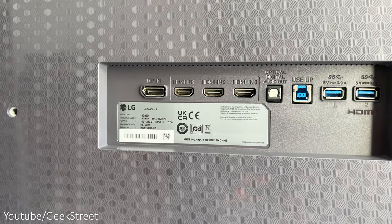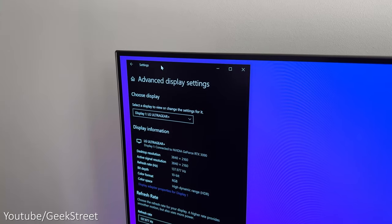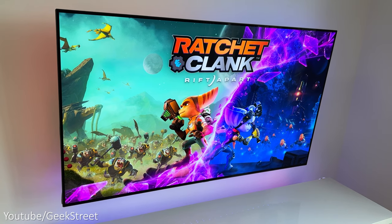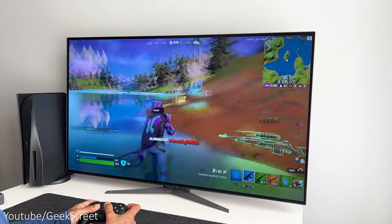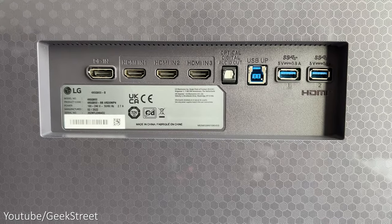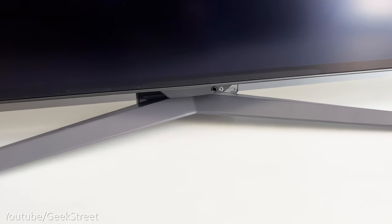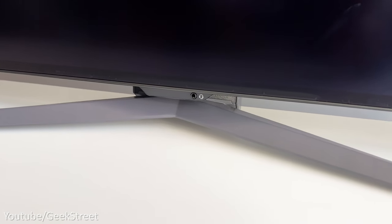Next are the interfaces — you get three HDMI 2.1 ports plus a DisplayPort 1.4 that can be overclocked to give a 138 hertz refresh rate depending on your graphics card, which is perfect for a PC but not something you get with an OLED TV. Then there's the insane response time of 0.1 milliseconds, faster than any OLED TV and perfect for FPS games. And finally, you don't get eARC or Dolby Atmos, but you do get a front-facing four-pole headphone jack supporting sound and microphone with virtual 3D sound via DTS Headphone X.